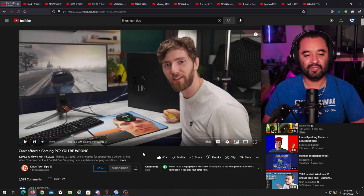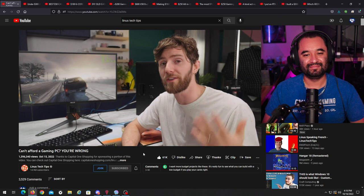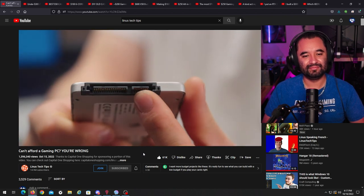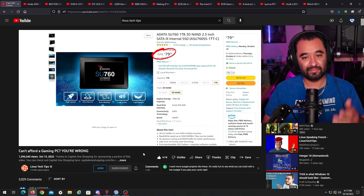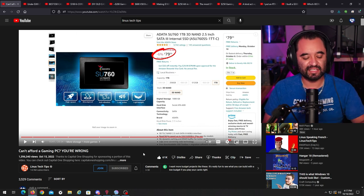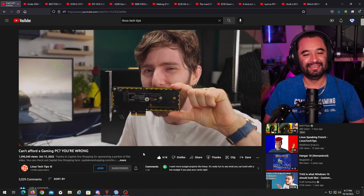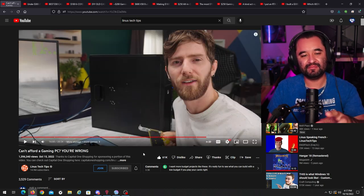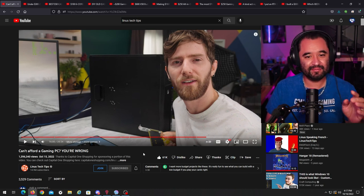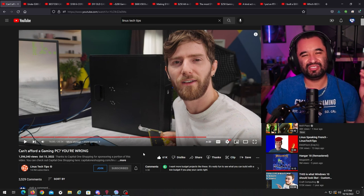The smart choice for storage is probably a 512GB or 1TB 2.5-inch SATA SSD, around $85 for a terabyte. On an NVMe SSD, DRAM cache is less important. The problem with NVMe drives on these systems is that only some Haswell enthusiast motherboards supported booting off NVMe - these workstations definitely couldn't boot off an NVMe SSD. So I'd generally suggest sticking with a SATA SSD. However, in Windows they can recognize an NVMe SSD off a PCIe adapter and you can make that your game drive if you really want the speed.